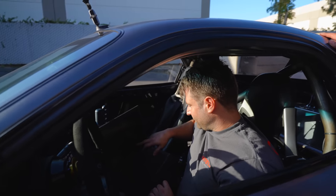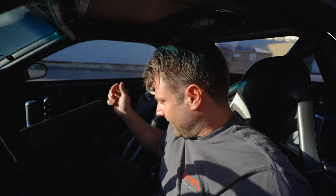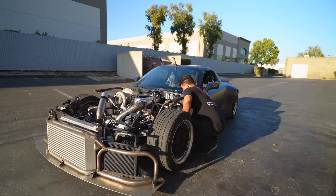Yeah, it's funny because you can see the front's kind of modulating the difference between the two of them. So that definitely has to do with the road surface. Okay, which is good to know. But we're still rear biased. So whichever way you went, we'll keep going more of that. I can do that. We're going to make it more front bias. It's already shortening our stopping distance. Those of you guys that are race car guys or into more intricate details, you see how empowering and safety encouraging this data is.